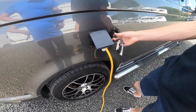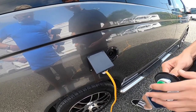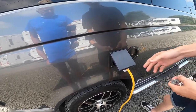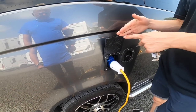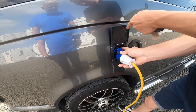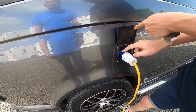This has got a fresh water tank on board — simply put your hose pipe in there and fill. It's not a very big tank, about 20 litres or so for the cold water fed tap in the kitchen. Next to it you've got your hookup blade, so this is where you hook up with mains electric. Always hook the van up first then the power source, and do it in reverse when unhooking. Simply lift the lead up and slide it on, and there's a small blue clip on the left-hand side which you'd push down to unhook.